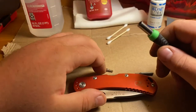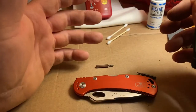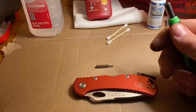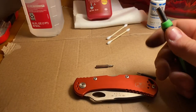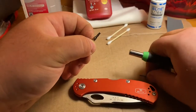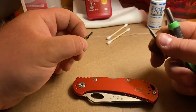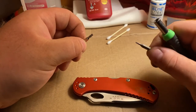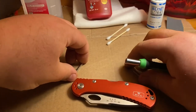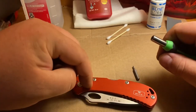I really don't use anything fancy or special. The screwdriver, the bits and everything are actually a set I got from Walmart — I think it was like $14 or $15. I'm probably going to be upgrading fairly soon because these bits are pretty soft. I keep breaking the T6s and they just keep getting mushed. So I've been ordering a little bit better quality bits. We're going to be using two today: a T9 for the pivot and a T6 for the body screws.